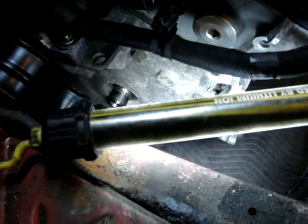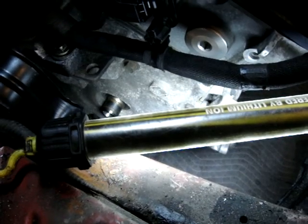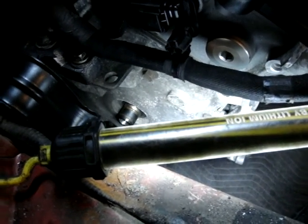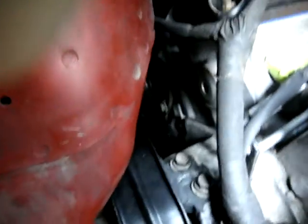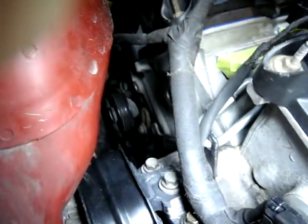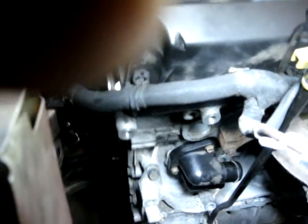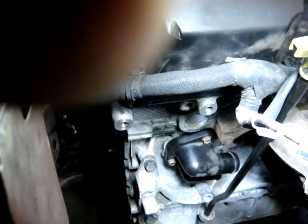You know, the tension pulley bracket, where the belt rides in between the pulley, goes around the alternator and back toward the power steering pump back there. So I moved everything on the side here, including the AC, which fits on that bracket right there, and the alternator fits right under there where those two holes are at the top above the thermostat. See those two holes? You see a left and a right. So that's what you have to do.